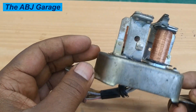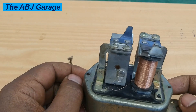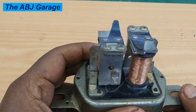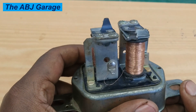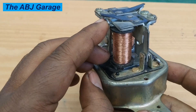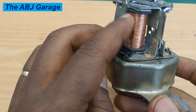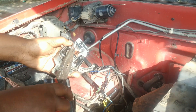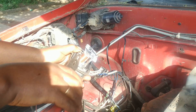As you have seen, even though the engine has been accelerated the voltage is not increasing. For this type of car electrical system we are expecting somewhere around 14.8 volts, but when accelerated the voltage is remaining low. So we have to pry the spring seat of the voltage regulator — bend it up using a long nose plier — so the magnetism required to pull the armature increases, raising the overall voltage of the charging system.